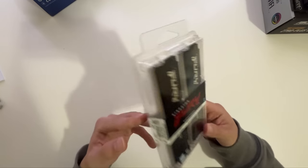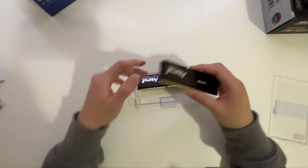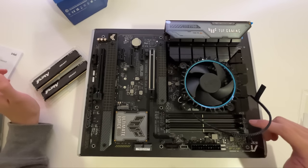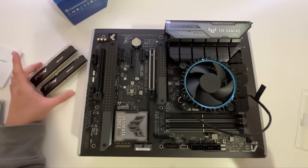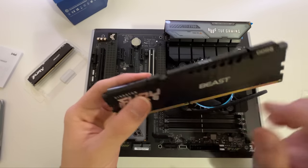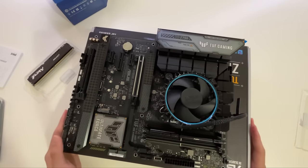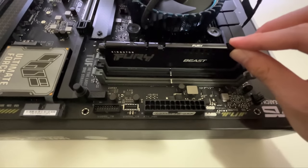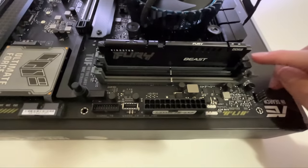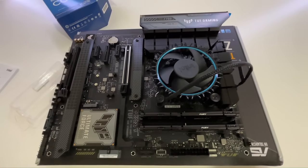So the next thing we have is the RAM — it's the Kingston Fury 32 gigabytes. I've installed RAM in the past, so I do know how to do this at least. Since we're only installing two sticks of RAM, we're going to be putting the RAM on the gray slots so we can take advantage of dual channel. Take one of the RAM sticks — as you can see, there's a little wedge-looking thing. Line that up with the little bar. Once you put it in place, this thing can just be snapped back into place just like that. We have the RAM installed.